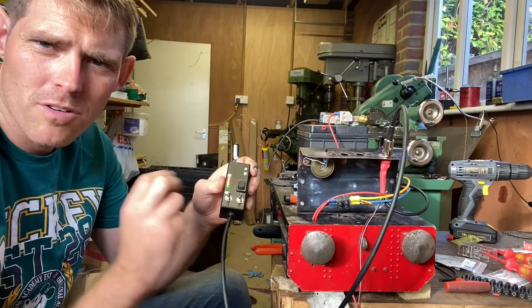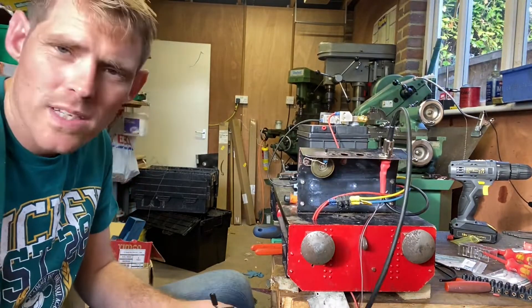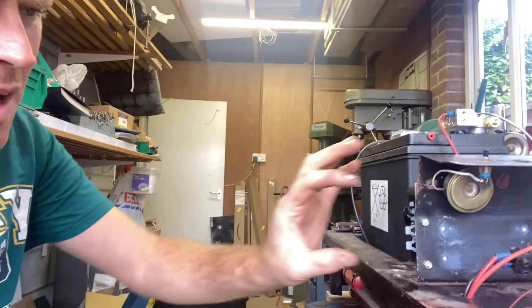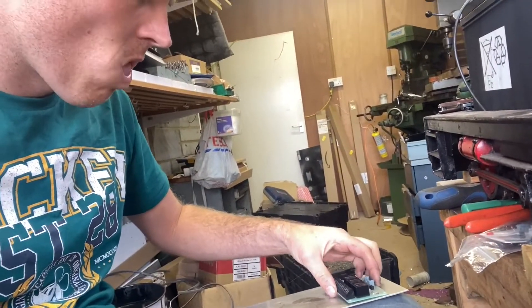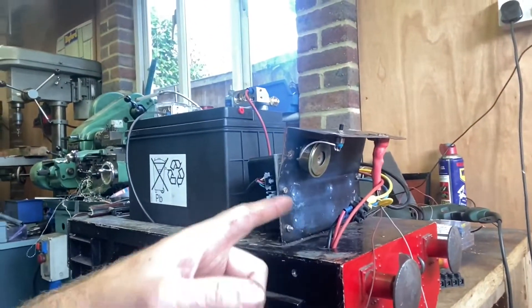So all that's left to be done is wiring the horn. The horn relay board was supplied with some little plastic spacers. I want to mount it in this area here, but none of the flat sections of plate are big enough. So I found a bit of aluminium — I will drill the holes, mount it on there, cut it to length, and fold the top so it meets that angle. Then it'll come down vertical just a little bit away from this, and we'll be able to mount it. Then that can be wired up.